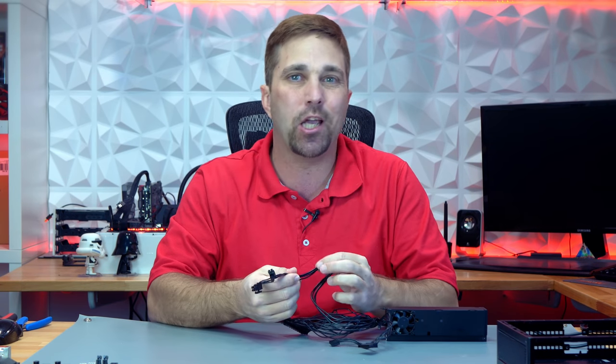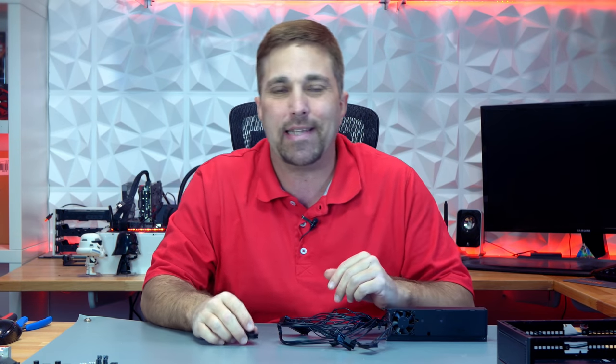Now that we've shortened the cable and moved the cable, the last thing we need to do to the power supply is lengthen the EPS cable so I can route it around the inside edge of the bottom of the case and keep it from crossing over one of the drive bays. This is probably the easiest modification because all we're going to do is make an extension. You can cut the cable and splice in a longer wire, but anytime you can avoid cutting and splicing power cables, the better. I'm ashamed to admit I'm a bit unprepared here — I have a box full of assorted male and female ATX housings but for some reason I can't find them anywhere. I just happened to find one random male EPS housing but I don't have a female housing. But you'll get the idea.